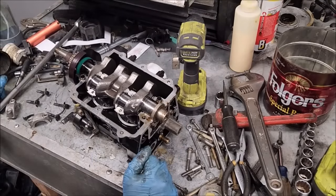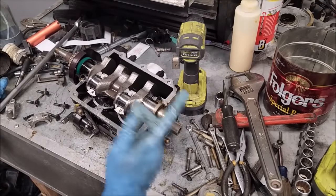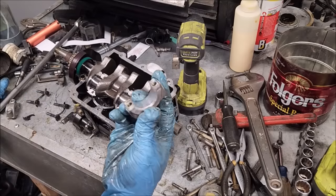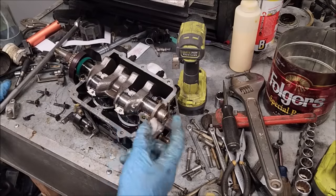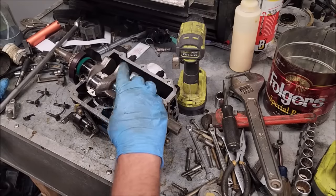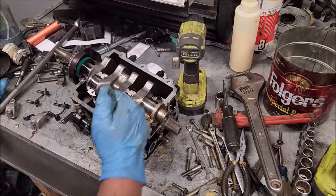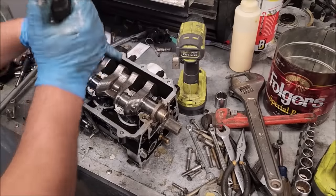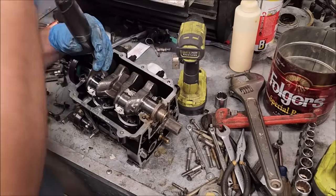So what I'm noticing now versus other outboards, notice no bearings here. Just a nice, smooth, clean surface. You know, on every other outboard that we've seen on this channel, we have bearings there. You know, little needle bearings. NASCAR type stuff, as most automotive people see it, or we see it as just outboard stuff.